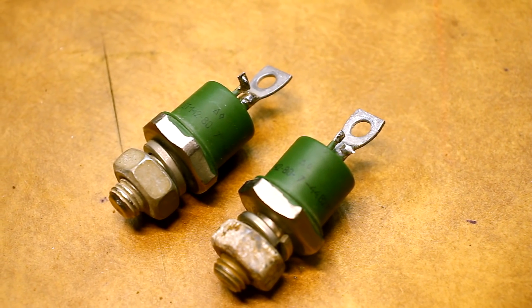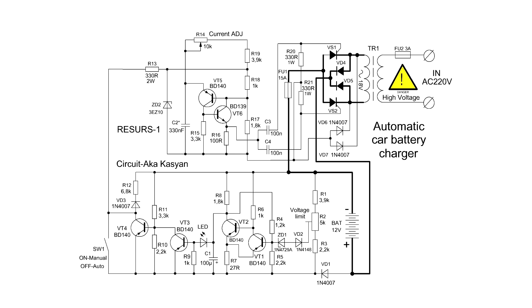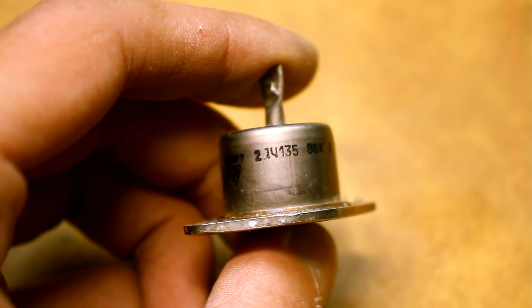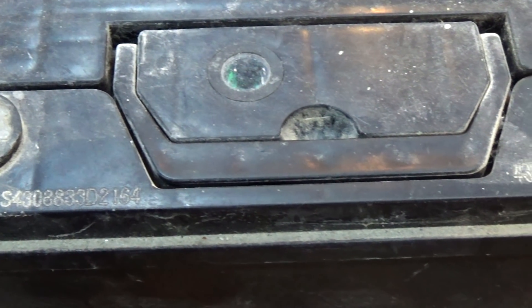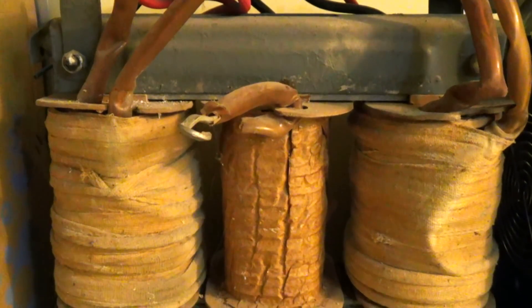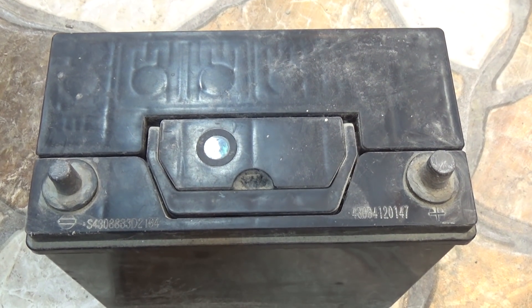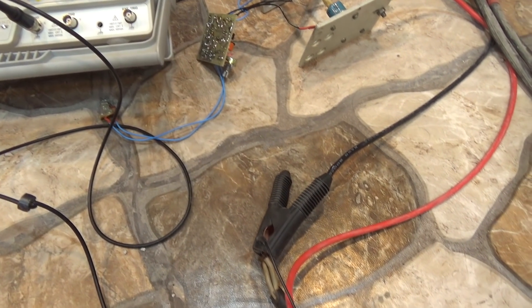I will use very powerful thyristors and diodes with a current of 80A. Considering the type of rectifiers and the fact that components actually withstand currents above their maximum values, as well as that starting a car engine takes a short time, such a device can start the engine — but only if a not-dead battery is installed in parallel. Theoretically, nothing prevents you from using such powerful thyristors and diodes with a 3kW transformer to get a starter capable of starting a car engine even without a battery. But I don't recommend starting the engine without a battery, as the output voltage is pulsating and the value of these ripples can be dangerous to the car electronics. If you have a battery connected in parallel, all this will be smoothed out.